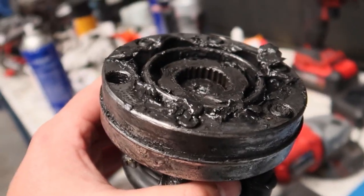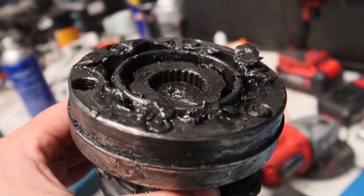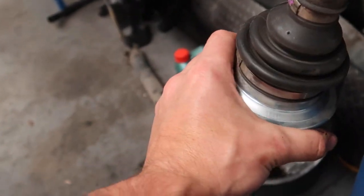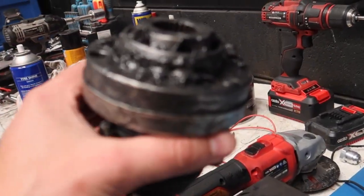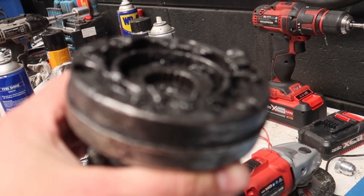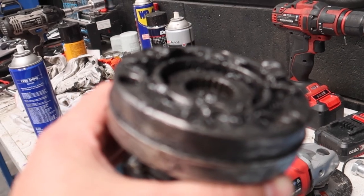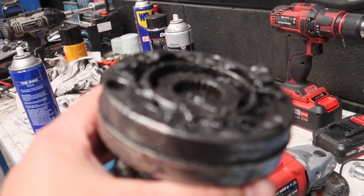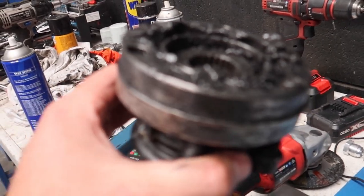And as you can see here, I've got some play in this axle, and that's at both ends. Okay, now this axle's still good. I took it out, it was working out of the car, and I'll keep it as a spare, but that play is not something that you really want because it's like a death gap, right? If there's play, then when you kick the clutch, boom, it's got that shake. That's gonna allow it to pretty much break at some point in the CV.